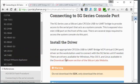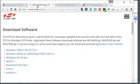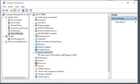This is the website — there are drivers here that we need to download from this particular site. Once they're downloaded, we plug in the cable and then we need to go to our computer management. You can find this in your start menu, or in Control Panel under Administrative Tools, and you'll find Ports here. We need to find out which port the driver installed.